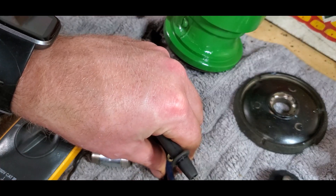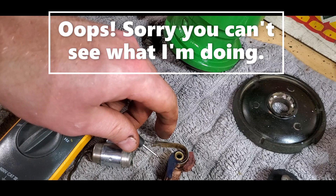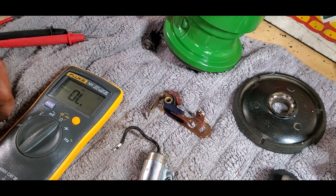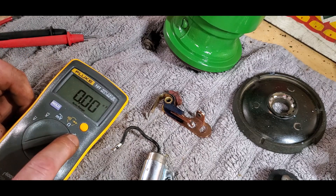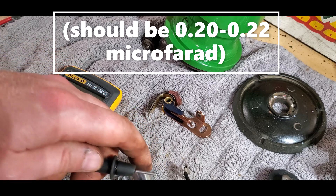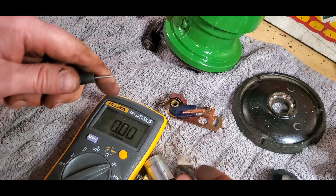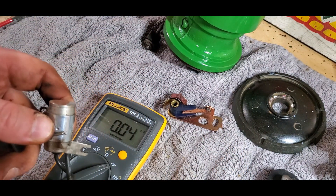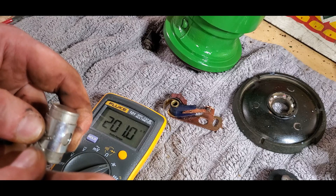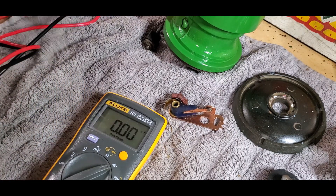So listen in for a beep from my multimeter here. When they're closed, open them up — it shouldn't beep, it should be open. Which it is. Now go ahead and check the condenser or capacitor. I'll switch my multimeter over to capacitance. We're looking for anything around 0.20 to 0.22 microfarads — that's what an ignition condenser or ignition capacitor should be. We'll ground it out first, make sure it's drained, then touch the negative here on the case of the condenser. There we go — there's 0.20 microfarads, which is 200 nanofarads. So this should be good too.